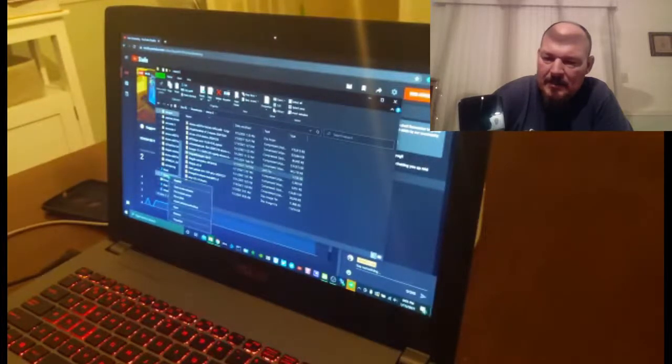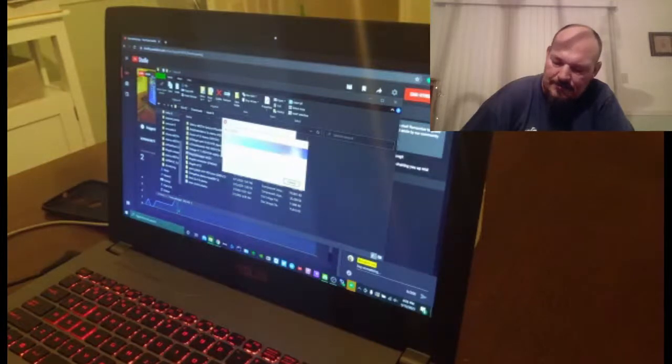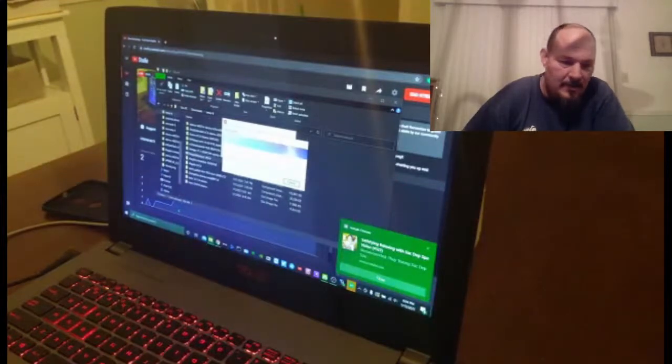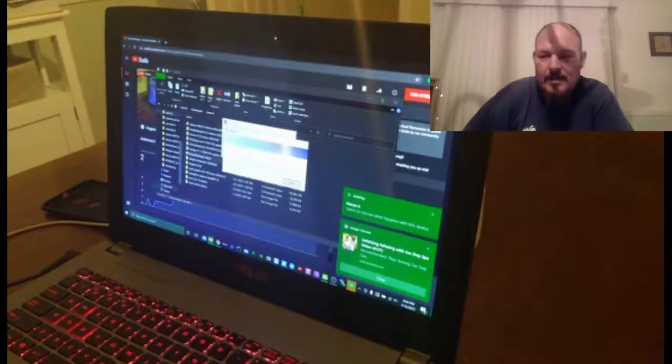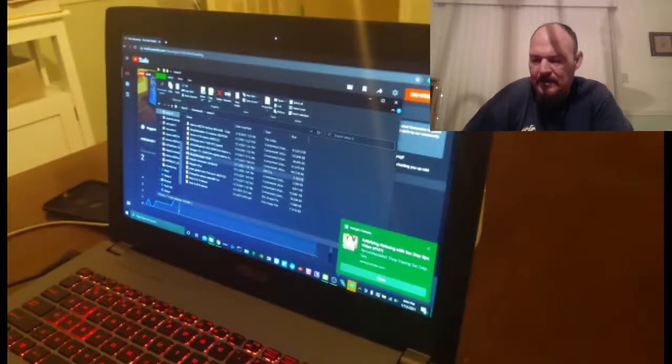I'll keep doing it. Go to the Nexus 6 and right click paste. Copy that file. Oh, man. I forgot to do my developer options. Sorry, guys. We're going to system, developer options. Oh, and by the way, this has full gesture support. So it's pretty cool. Go down to USB debugging. And we go down here to USB configuration. Click on file transfer. And then we will do this again. Right click paste. I did copy that file over there and it should be in internal storage.